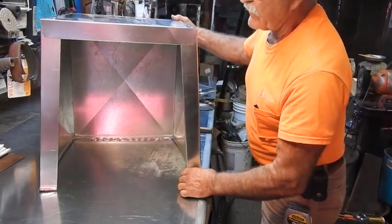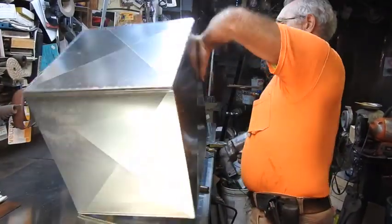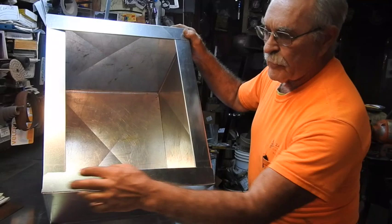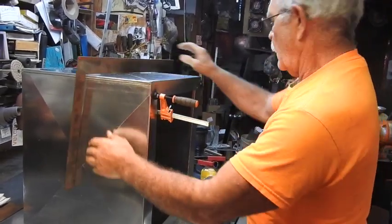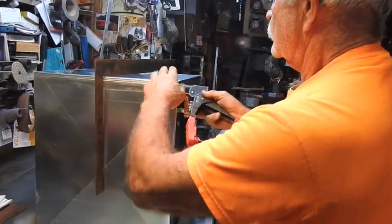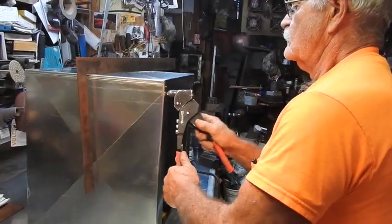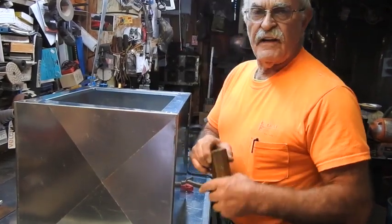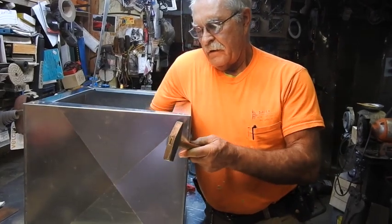Put the other plug in and we'll come back and blast these down with an electric hammer. We're going to put a square on this, double check to make sure it's square, and put two pop rivets in each corner. One pop rivet will still allow it to flex back and forth — it'll turn from a square into a diamond — so two of them will keep that from happening. It's pretty simple to set a square up on there, get your clamp ready and just sandwich it down real quick and easy. Putting that clamp inside holds that bottom from bending in when you penetrate the outer skin with the drill. Once you get them pop riveted in place, get a chunk of brass, hold it right up underneath there, and set those rivets. The aluminum rivets take very little to set.